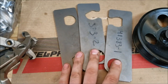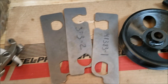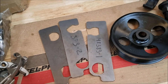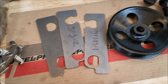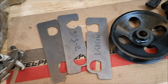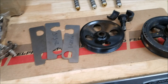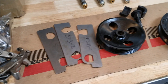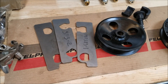Here are the cam holding tools — these will hold the camshaft in place while you're setting the timing. I'm going to link a great video by Cloyes; they discuss how to install the timing chain and the process is a lot easier than you think. The hard part is just taking this thing apart and getting the heads out of the car. Putting it back together just requires a lot of patience, but you'll get it done.